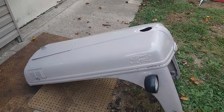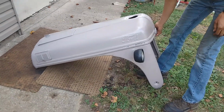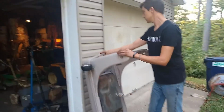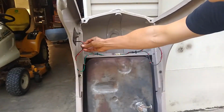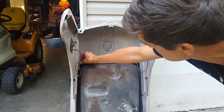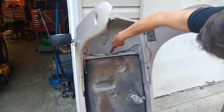From, you know, in certain light it doesn't look bad. Of course, it's all rusted through and everything. And then I went ahead and rewired the lights. They had Scotch locks for connectors on the lights. So if you come in here, you can check out. Ran heat shrink through there. Ran some nice long lengths of loom here so I can tie them up on both sides. Tried to get them somewhat symmetrical.